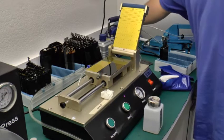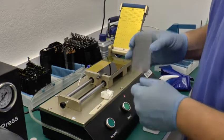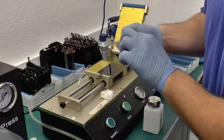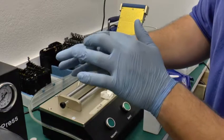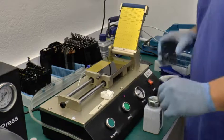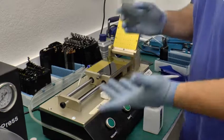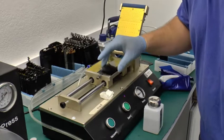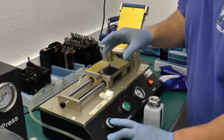And let's get a polarizer. Now these polarizers, there's a trick to them. If they have writing on them, you want to see where the markings actually are. I just wiped that one. Wherever the marking is, that's the side that gets peeled and put down. Okay? To align this and not go crazy having some sort of an alignment thing up here, the easiest thing you should do is to put the polarizer down right on top of your target. Make sure your vacuum's on, and then I'm going to align it while I'm doing this.